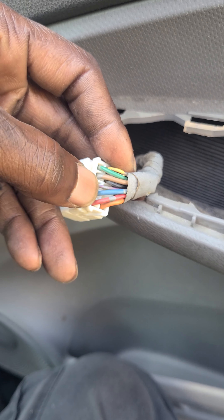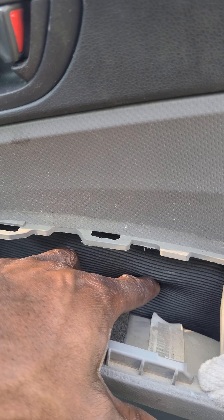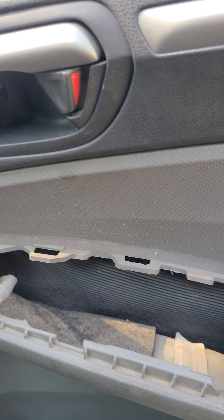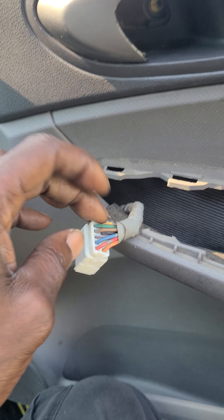The red and the blue wires connect directly to the motor. What you would do is take the door panel off, go to the plug on the motor — it's going to be two wires on it. Get one power, get one ground; the window should go up. Switch it around: get one power, get one ground, the window will go down. Simple. If that works, you know your motor and your regulator work, and we need to go to the wiring.